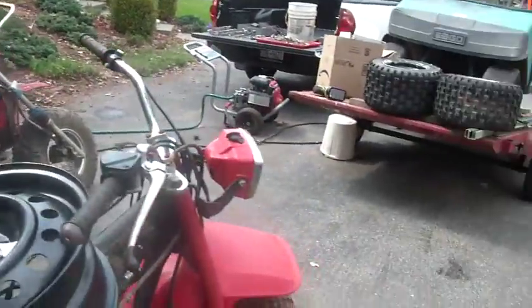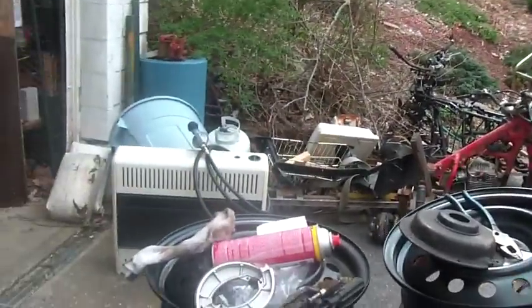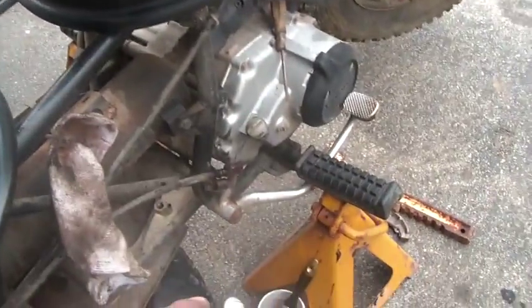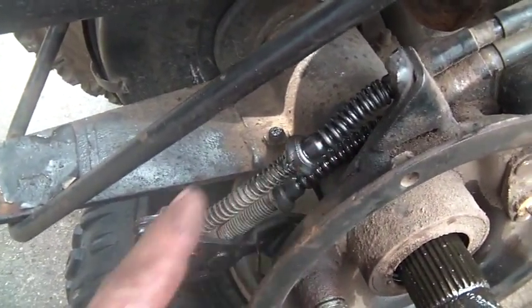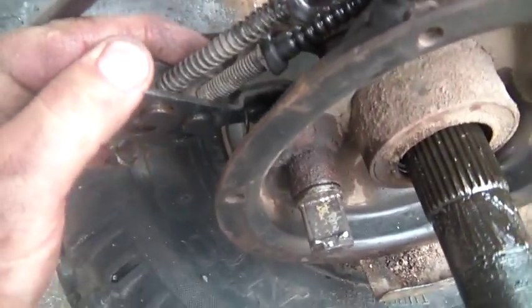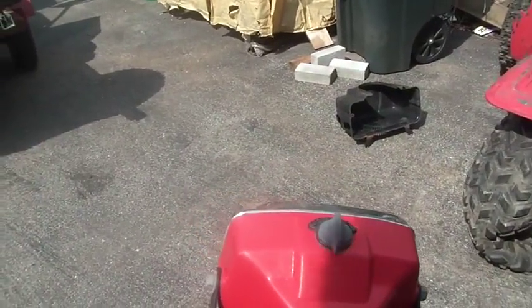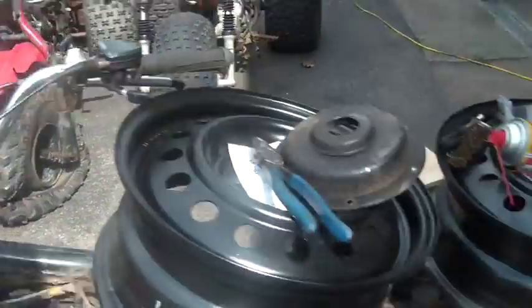Most of you are familiar with doing a brake job, no big deal. What I did was use my tranny fluid diesel mix on the cables and lubricated them all in here. I made sure this thing is moving nice and smooth — it turns really easy, nothing's bound up. The cables are generally moving nice; the foot brake cable is anyway.